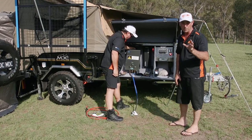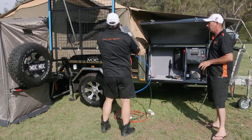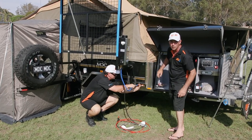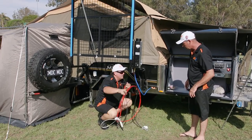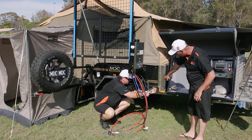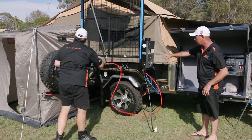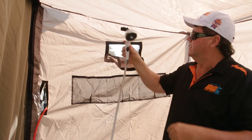With all Cape Yorks, you get the Country Comfort Instant Hot Water System. Steve's got it here and he'll show you where it hangs on the boat rack — simply hanging on the little hook from the boat rack. You've got two hoses: your cold water hose fits into your cold water fitting from the side, which pulls water from your tank. It's just a quick connect fitting — straight in. You've also got your hot water hose — slide that into the bottom of your Country Comfort and put your other one into the hot water connection, so now you're getting hot water to your kitchen area as well. Last but not least, the long red hose is for your shower head for your en suite — feed that through, zip it through the side of your en suite, hang it on the inside. Instant shower.